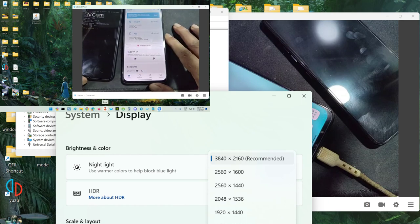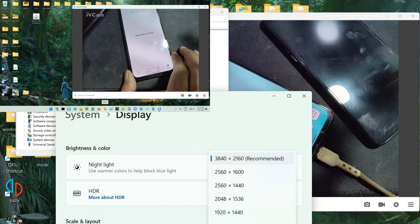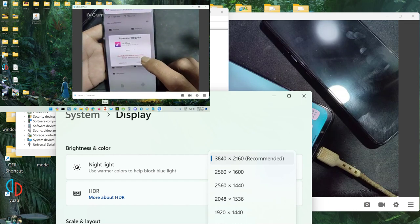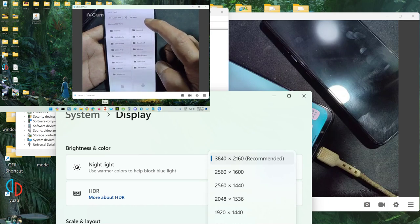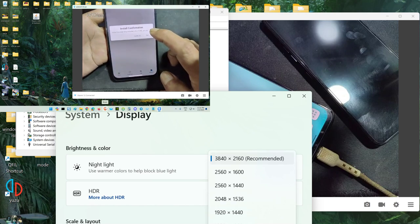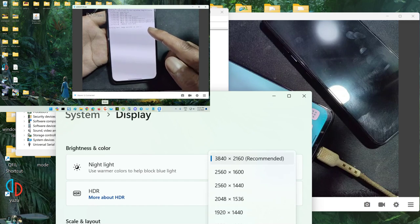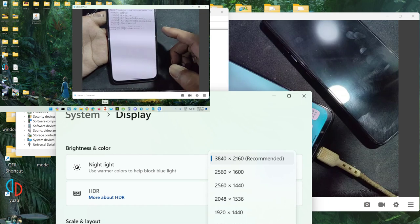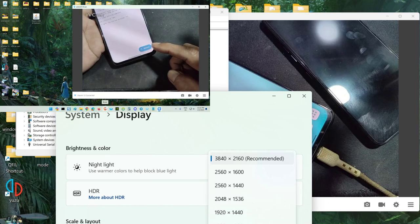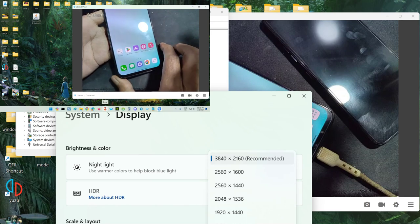Device already rooted. Okay, for the TWRP, go to module. Just now the TWRP for V50. Install from storage. Run from the internal storage. Search for that TWRP. See? TWRP. Install confirmation. Okay. This TWRP is patching slot A and B. Done. That's it, you got the TWRP. No need to reboot because you already got the TWRP for this V50S and the G8X.